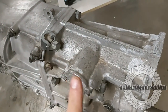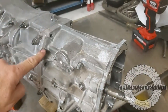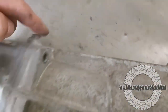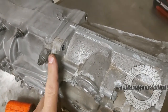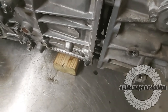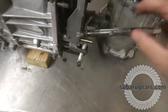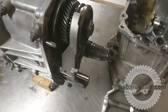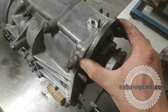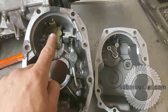We're going to remove the center differential housing by removing these bolts, but we won't discard it because we need some of the parts from here transferred to the cast supernose — we'll retain it and swap over the parts. We'll try not to use the screwdriver in here because we want to keep this mounting face nice and perfect, as we'll need to reseal it when we put the supernose on. We've managed to split it and take it off the dowels. This is the center differential housing with the shift stick — hockey stick as you like to call it.